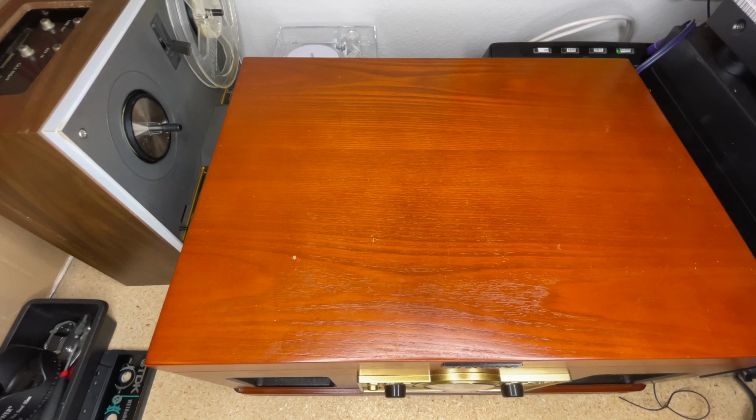I'm a little nervous to do this video because of the way that the Victrola one went the other day. I didn't expect it to destroy vinyl, especially considering when I first tested it, when I reviewed it originally a year or two ago, it did fine. It tracked at about 5 grams. It didn't seem to do any damage, but I weighed it again, and it was 7.5 grams, and it carved up Enoch Light. So I got to thinking, what about my Encore?